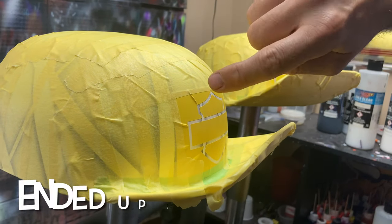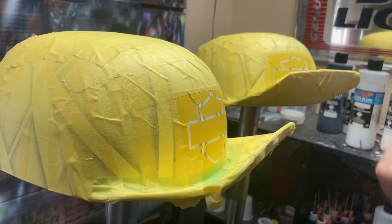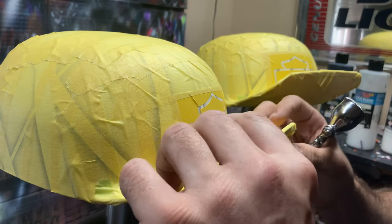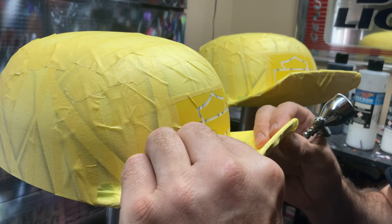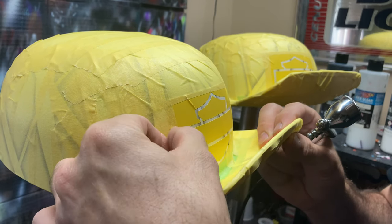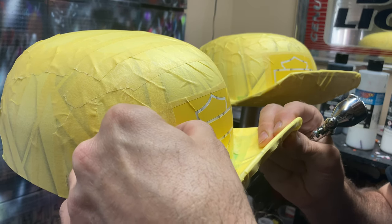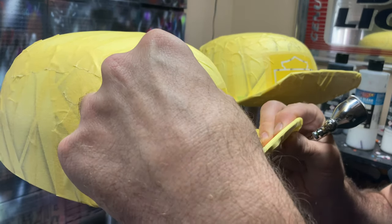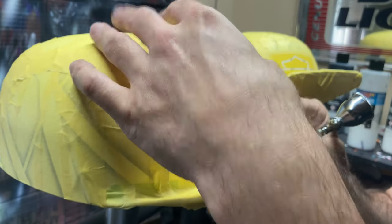And then if you could see where the vinyl kind of bunched up, made those creases. I always like to come in with my fingernail on each side of that crease, try to push the vinyl together. And then right along that edge, I take my nail and push it down. That way we don't get any bleed up underneath of there.